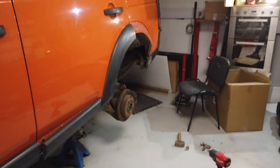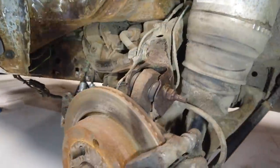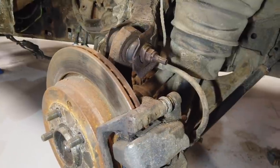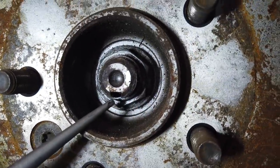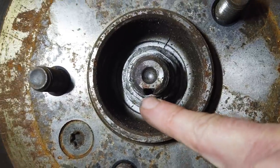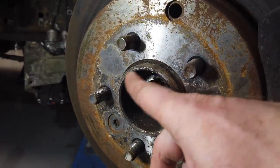Gary's going to do this today because we also bought ourselves a new impact driver - we're going to give it a little test. Hub nuts are interesting because they have a little ring around the outside. On the bottom of the hub nut you've got this little pointer - there's a groove in what is effectively the threaded part, and what they do is knock that in to form a lock nut to stop the nut coming undone. I've checked by running my finger around the thread - this is a conventional thread, so to remove it we have to go anti-clockwise.